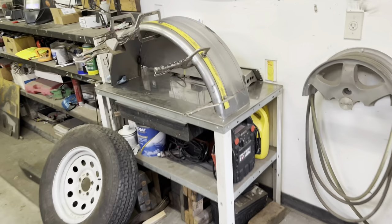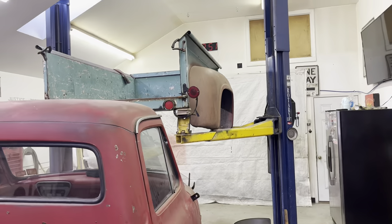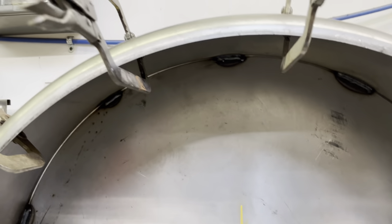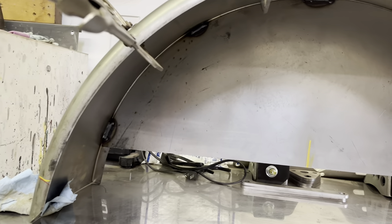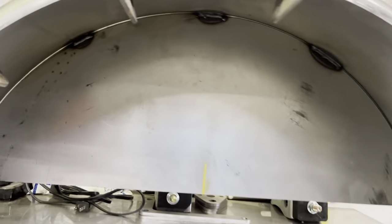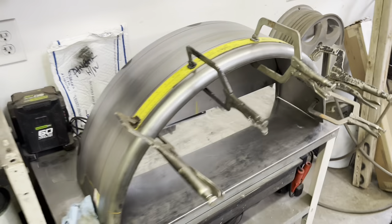The other thing I will be cutting is three inches off the bottom of each one — that's gonna give me 12 inches of height, which is exactly what I need. It's gonna bring it just below where the bolts for the factory outer fenders are. I want a nice rounded transition on the inside of the bed, so I'll be cutting these welds off of that backer plate once I get it sectioned, and I'm gonna bring the backer plate out to the surface and weld it in. That way it's got a nice smooth radius on the inside of the bed, and that'll leave me a lip to put some holes in and bolt it to the bed wall. I'm gonna bring this thing outside so I'm not making a big mess in the garage, and we'll start cutting.